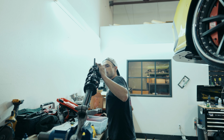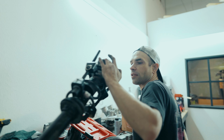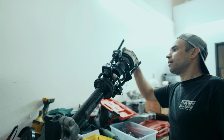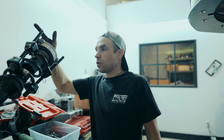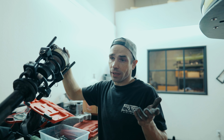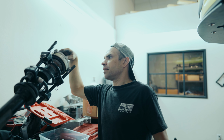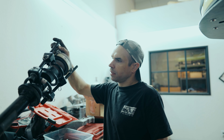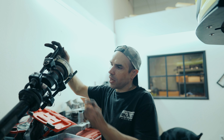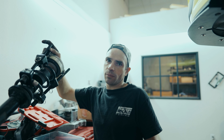So now these are a little funny because of the electrical connection. So just take your time, be careful when you're separating these. Use a 21 millimeter socket, preferably with a hex flat on it. If you don't have one, grab a pair of vice grips or something, grab the outside of it. And then inside is gonna be an M10 triple square. You wanna hold onto that and spin the nut free from it. You do not want the shaft spinning, especially on these electronically dampened struts.